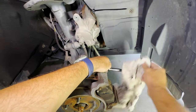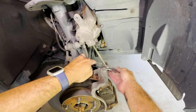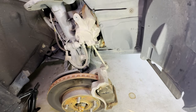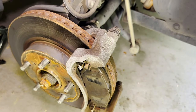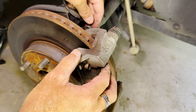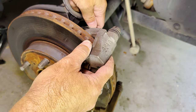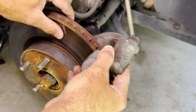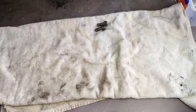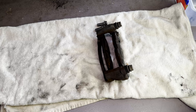I've used a rag to protect my spanner — there we go, nice and loose. After removing the bottom 17mm bolt, remove the top one. Be very careful when doing this as you don't want the bracket to fall and get damaged on the floor. It should just pop off like that. Place the bracket on a rag or a towel so it doesn't get damaged, and now let's get onto the rotor.